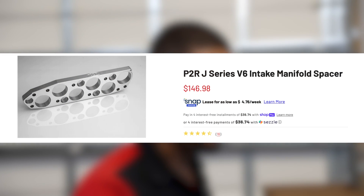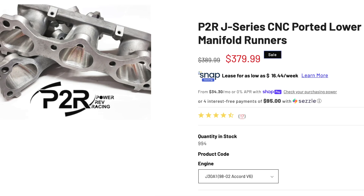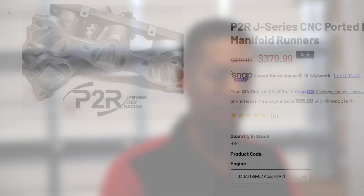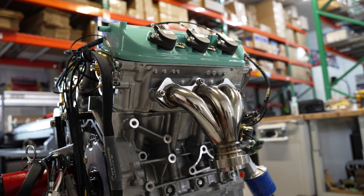This motor — we didn't really have major concerns with 7,000 RPM or anything high up there. So we are going to be using an intake manifold spacer. We have a set of our CNC-ported intake manifold runners on here, and also the upper manifold. We're going to use a little bit of extra runner length in there to help keep our power curve really low.